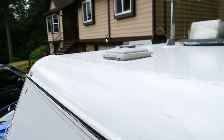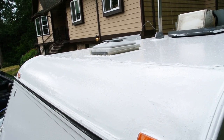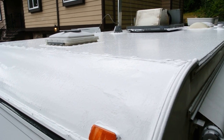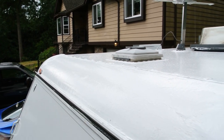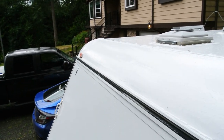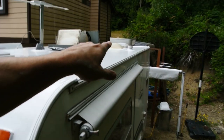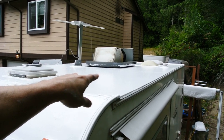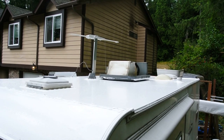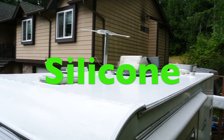One of the other things we had a concern about was this curve here — you can see it's got ripples across it, it was just old. I don't know what caused the issue. The stuff on the side of the trailer is a different material so it was causing a little issue with wrinkles across it. We haven't had rain for quite a while. I went ahead and coated all that — the whole front curve, the roof, and a little bit of the curve at the back. The bottom plate under the A/C unit you actually have to disconnect the entire unit to get underneath it, which I was not going to do, but when I do the second coat I'll go back and rubberize that too.